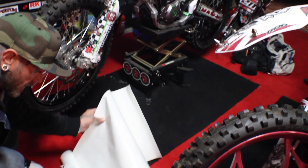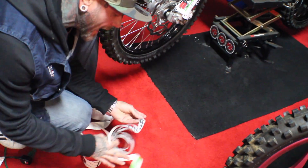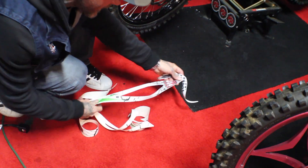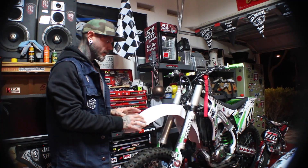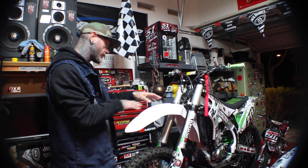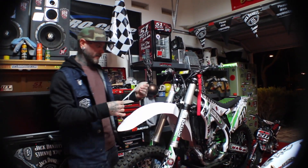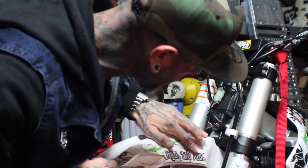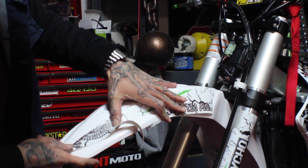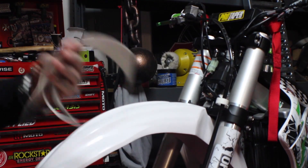KX front fender — as you can see, just the front fender has quite a few pieces. I always like working with the stuff warm, so I like leaving it inside in the house. These are all front fender pieces. One thing you can do is lay them all out and use masking tape so you know where every piece goes — probably not a bad idea. Always start with your bigger pieces. This one is obviously going to be a side piece. You should have two of those. It's going to go right there.